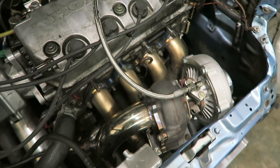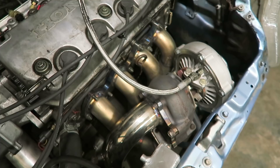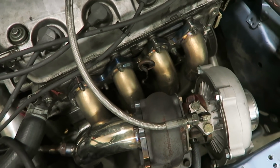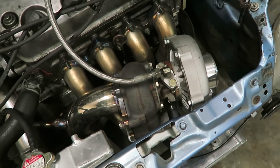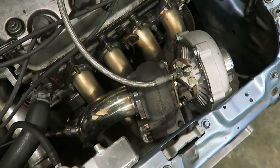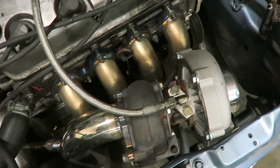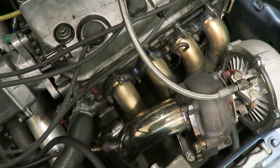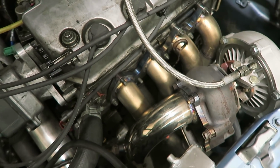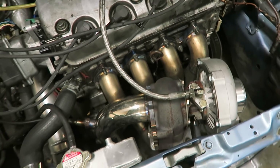And I have about $250, I'd say, in material. So I ordered 12 90s and about 2 feet of straight and the collector from Silicone Intakes. And that was about $190 for all that. And that's all Schedule 10 1.5-inch stainless tubing. And the head flange was about $50, I believe. So a little more with shipping. So about 240 to 250 bucks for all the material.